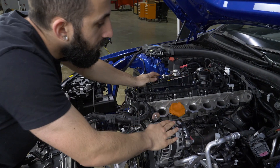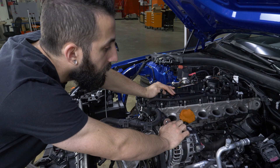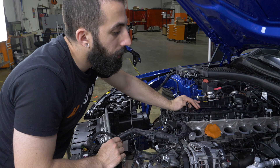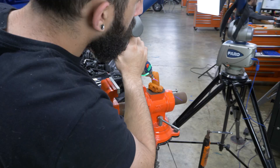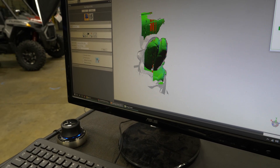What I'm doing now is putting Play-Doh inside the cylinder head, inside the intake port specifically, so I can get the exact shape of the port. When I pull it out, it's going to be the negative of the port, and I'll scan it and use it within the model so I can have a smooth transition from the intake manifold into the port.